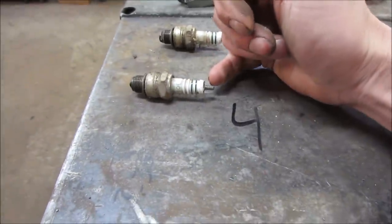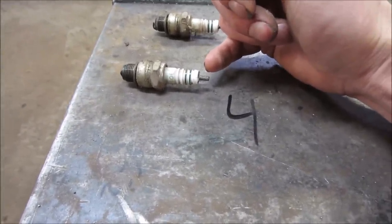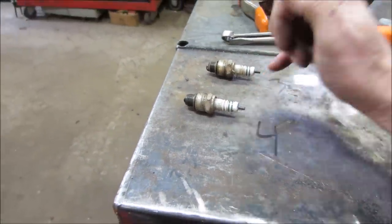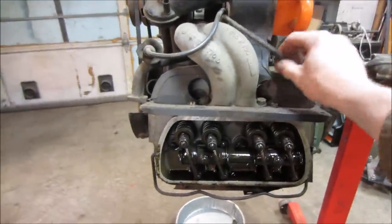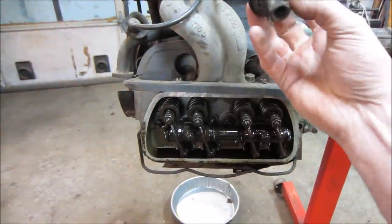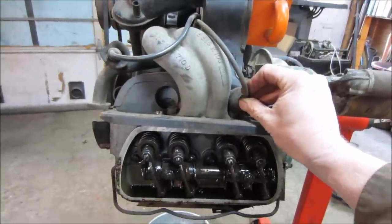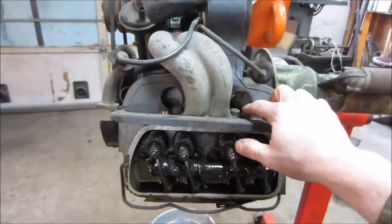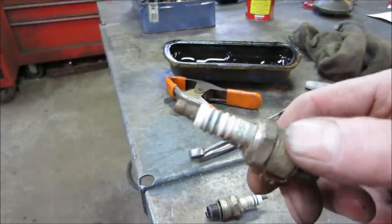These are the better setup too. This is the original Bosch plug and wire setup. It ratchets and holds on, because a VW is cooled by air, and through the plug location, this is the fan right here. You have plugs with a boot over the top of them. That boot gets pushed in over the plug, but air is trying to push that plug wire off a lot. So the first style that I showed you is much better than the standard that everybody's used to now.